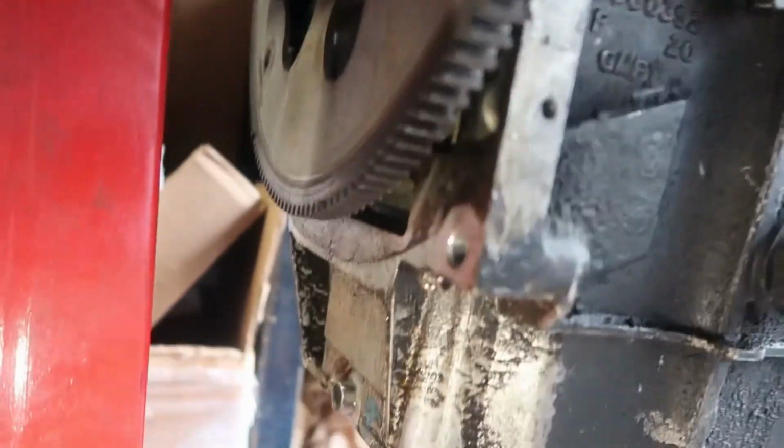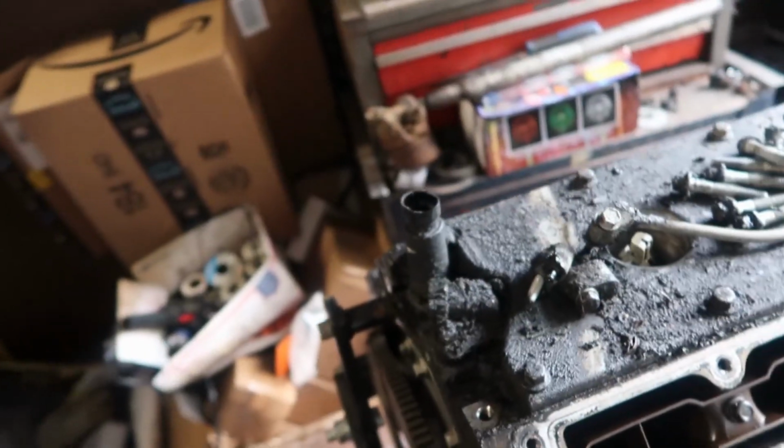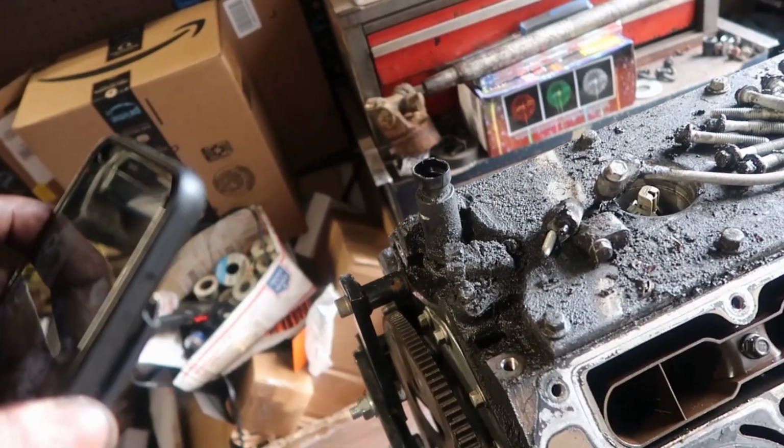The rest of it though, I guess I should come here and I'll show you guys. The block itself is actually painted black. New cam sensor and stuff, so yeah, it had a leaky oil pan gasket, a leaky maybe rear main? Not even rear main. So it just had a leaky oil pan gasket, leaky valve cover gaskets, and yeah, it's an LS. All of their oil pressure sensors leak like crazy. Maybe even the rear cam sensor, but I'm stoked. We got it torn down.